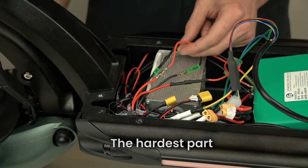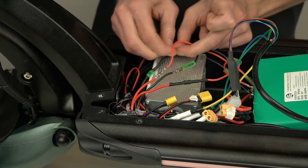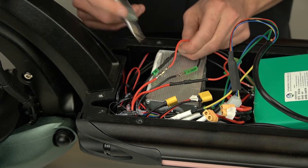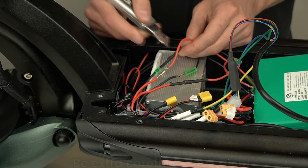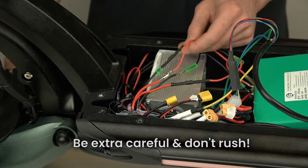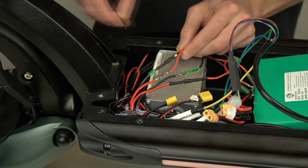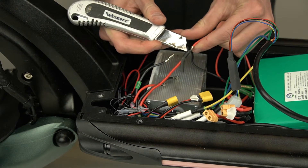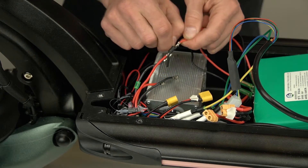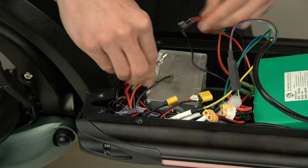There are four charging port wire connectors on our NANDROBUT D6+. The amount of battery connectors varies from brand to brand and model to model. There are two charging ports on our NANDROBUT D6+, which means we have two red and two black wires. There is electrical tape around the charging port connectors that you'll need to remove. Carefully cut the old tape with your pocket knife like we are doing here. Now disconnect all four charging port connectors, and please remember to keep them all apart in order to avoid short circuit.